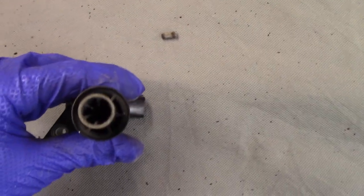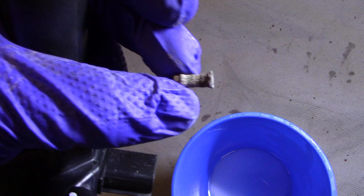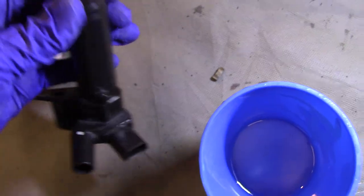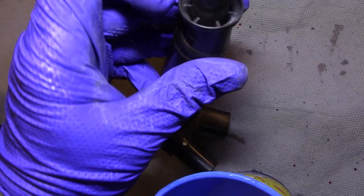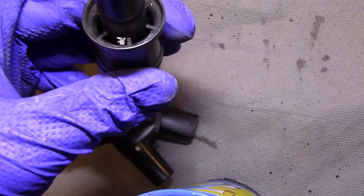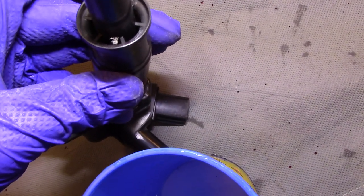If not, we'll have to buy a new coil, but we'll see if we can salvage this one. I took it apart and tried to clean it up the best I could. Like I said, it's all destroyed in there — you can see on this piece here how bad that is; that was the contact up inside the coil. Then I discovered where the problem actually is once I got it all cleaned up. If you look right here on the side of the coil, down in the side you can actually see daylight — because there is a hole blown right through the side of the coil, and that's where the spark was leaking out.